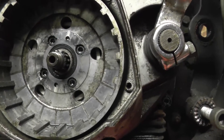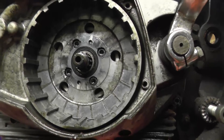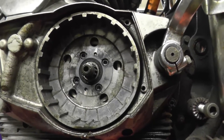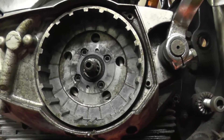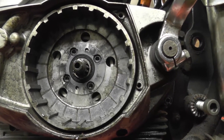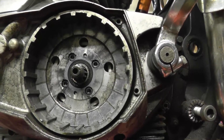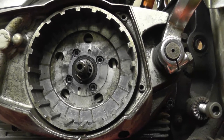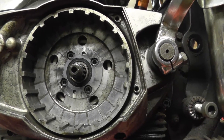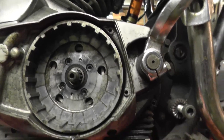You can't get that sleeve out very easily, so I've got to pull the clutch basket. To save the customer some money so I don't have to remove the entire side case, I'm going to make up a basket puller tool that will locate the holes in the basket and allow me to separate the basket from the primary drive gear. The other thing which surprised me — and I don't recall seeing it before — is that normally the nut that retains the clutch hub has a seal in it for the lifter, but this one didn't. And I had another problem with the clutch, so let's go have a look at that.